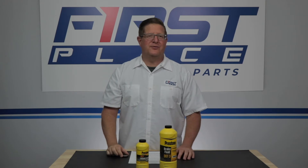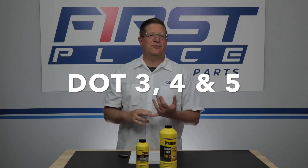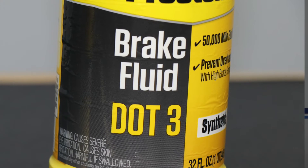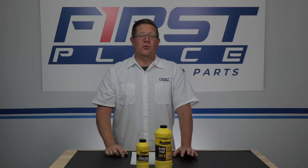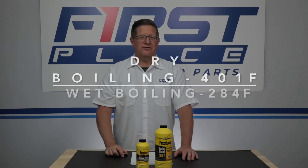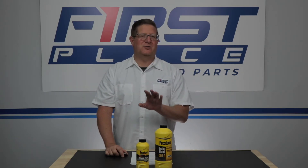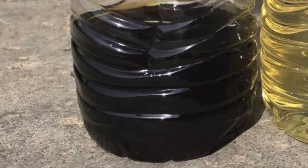The three main types of brake fluid we're going to look at today are DOT3, DOT4, and DOT5. DOT3 brake fluid has been around for a long time — it was used in vehicles all the way up to the mid-90s. DOT3 has a dry boiling point of 401 degrees and a wet boiling point of 284 degrees, which shows just how much brake fluid is affected by any water that starts to accumulate in it.